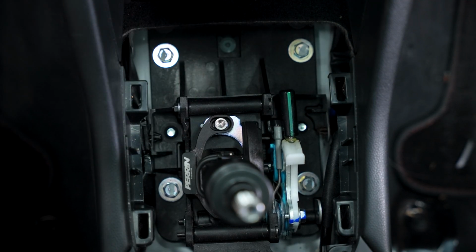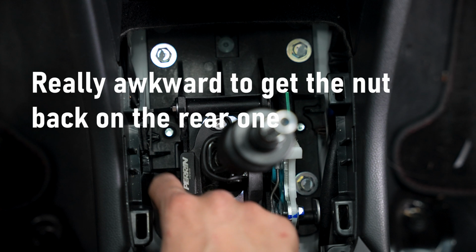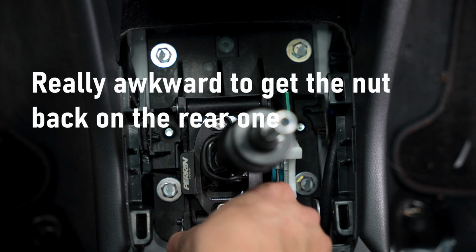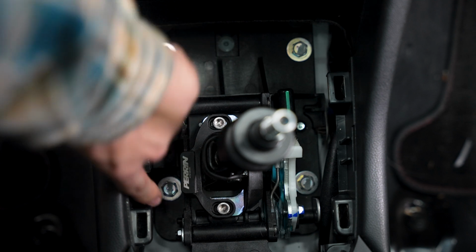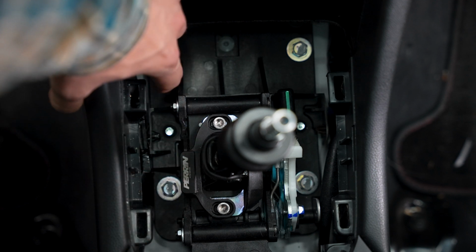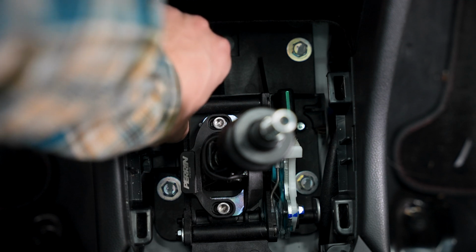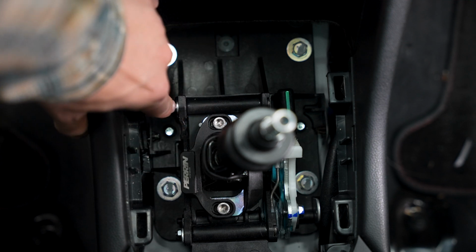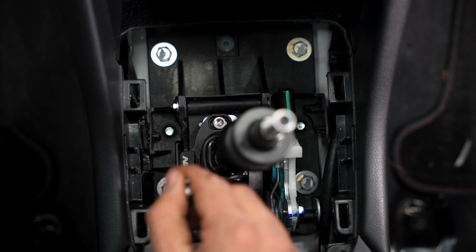Leave it kind of loose so it's barely touching the washer. Got it. All right, now you want to get them somewhere around hand tight, because before you tighten them down, you want to make sure that the washers are centered on the studs before you tighten down your nuts. All right, I think those are about as center as I can get them.